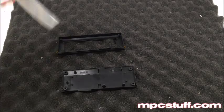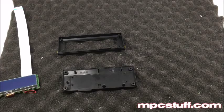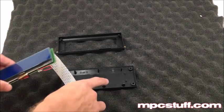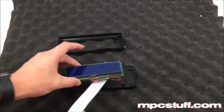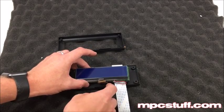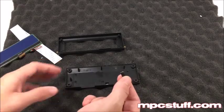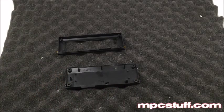Now that you have your new LCD, it's ready to go in. The first thing that you're going to do — this is not needed and not necessary, but it's going to make it fit a lot easier if you do it this way. This middle peg is not very load-bearing. There's not really anything that's going to have a problem because it was actually used to hold the old LCD in place right there. But you'll notice when you put it in, it's very close to this — it doesn't hit, but it will rub a little bit there if it's kept there. So it's actually very simple: push it one way, it'll break off cleanly every time. Don't worry about it not breaking cleanly — it just does.